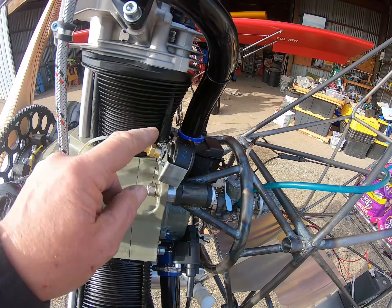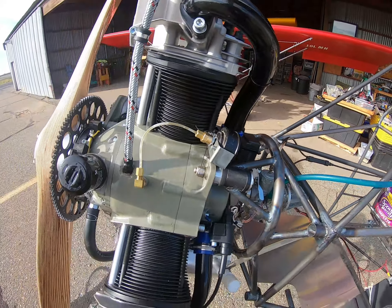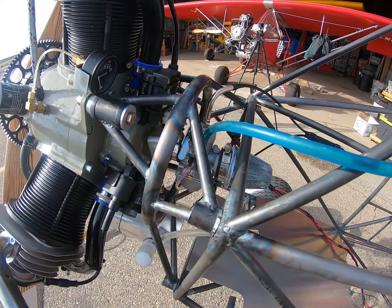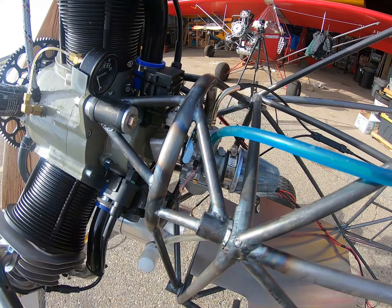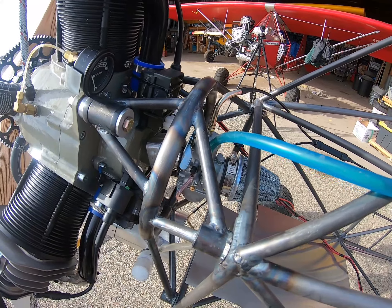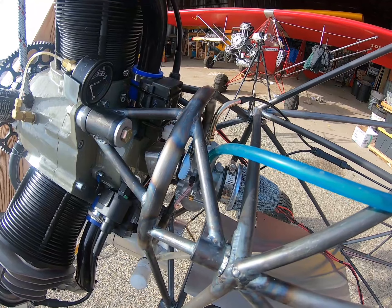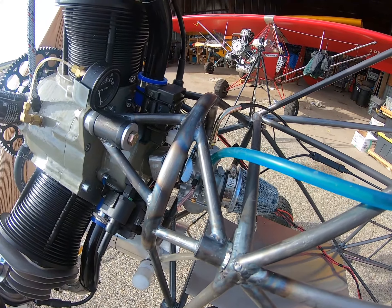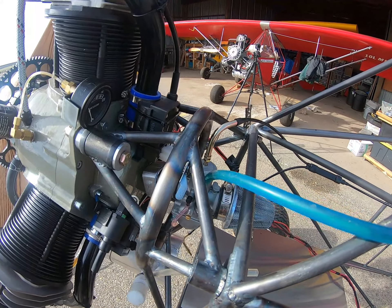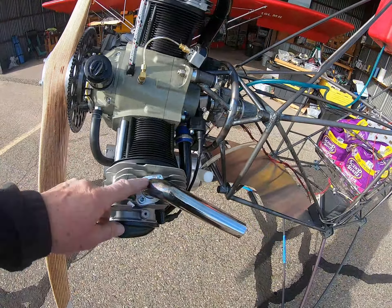If the mount doesn't work out, that's a whole different issue. I've got my fill over here. One of the other things I'm going to do is mount my oil pressure gauge up in this area here. I've got a 1½-inch oil pressure gauge, but I didn't get it installed in time for the test this morning. This is a 28-millimeter VM28 Mikuni, and it's factory stock — came out of the box. The mixture and the idle — nothing is set at this point in time. That's going to have to be refined later.